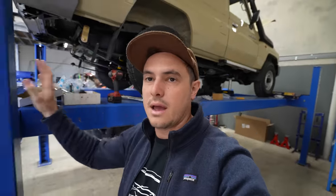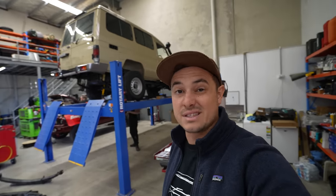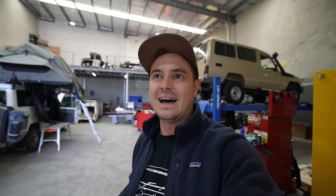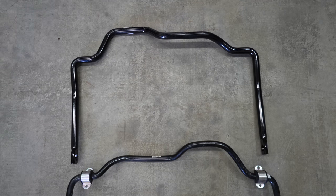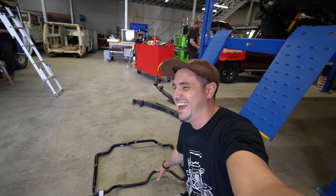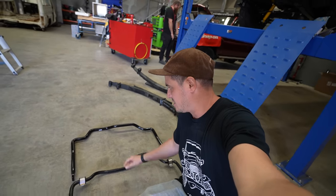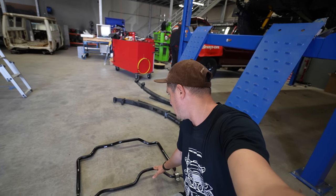Parabolics are in. The rear shockies are in as well. Sway bar is going in now. And then Aaron can get started on the front with the coils and the shockies. Pretty exciting — parabolics look great. Can't wait to see how it sits when it goes on the ground. It's going to be interesting even though the car has no weight in it, because they're parabolics and they're sort of adaptive with what weight is actually put in the car — it might actually sit really well empty. Down on the floor here we've just got the sway bar. Here's the stock, and here's the one you get with the GVM upgrade from Terrain Tamer — it's just a lot bigger, heavier-duty piece of gear.